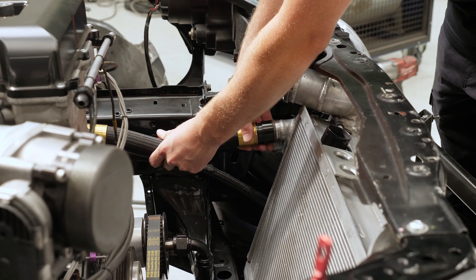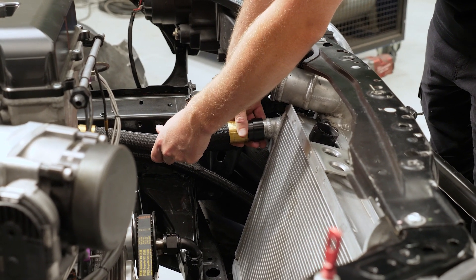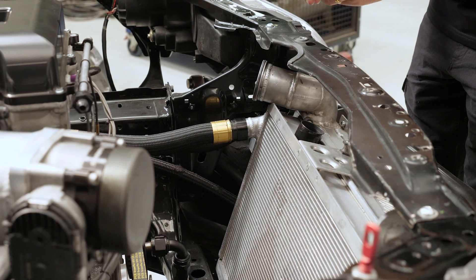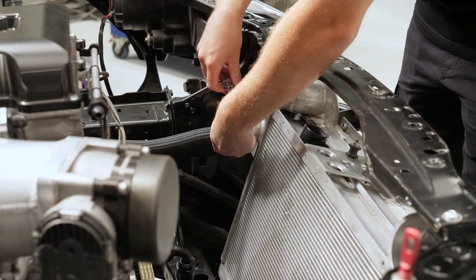Depending on the supplier, the outer clamp will have some form of button, latch, cap screw, pin, or other mechanism to hold it closed. The other type of clamshell pipe clamp is a Wiggins clamp, and as you might have guessed, this is a design from Wiggins Connectors. Although there are imitation versions, the Wiggins W900 clamp is designed and manufactured to meet aerospace and military specifications.